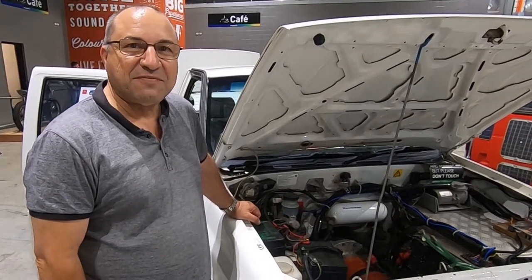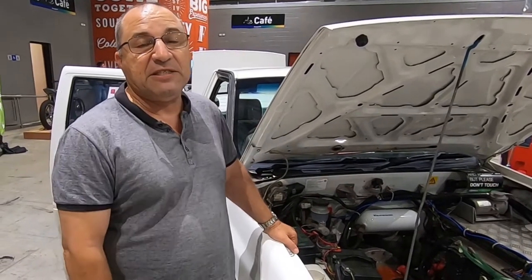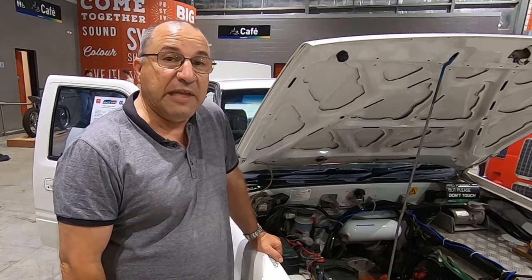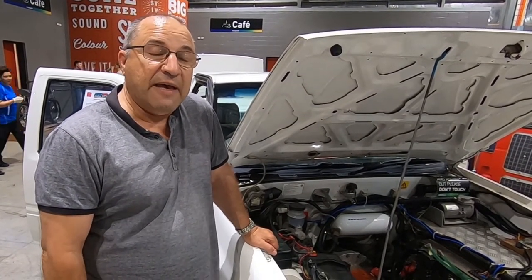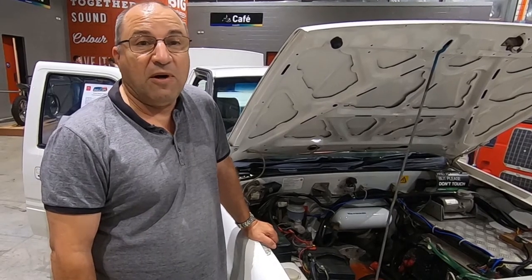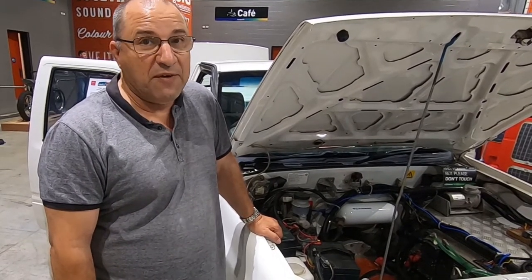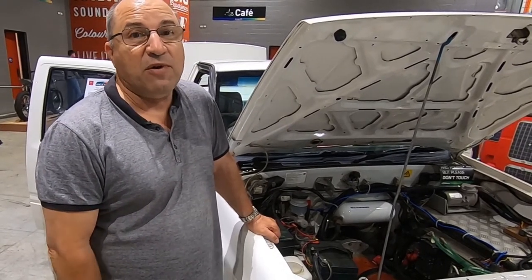So how long does it last? How many Ks do you get to it? Okay, well, at the moment on this, since 2008, I've now clocked over 71,000 Ks. On the lead acid batteries, when I started, I had 24 6 volt batteries, and that used to give me a range of 50 kilometers. I'm now on a 20 kilowatt Nissan Leaf battery pack. I've lost 500 kilos off the back axle, and I've got a range of 70 Ks, but much more reliable.